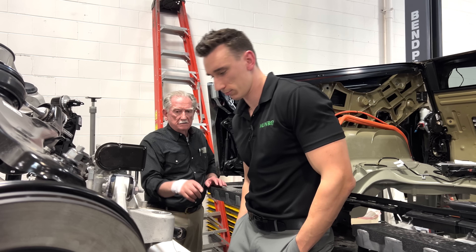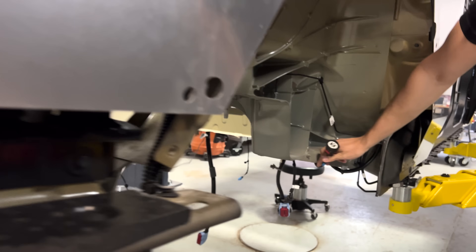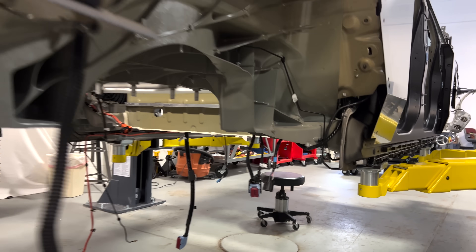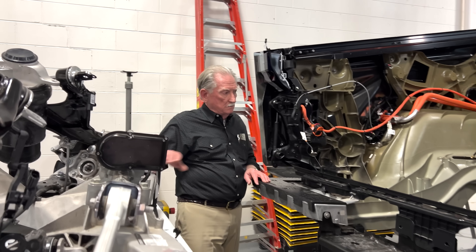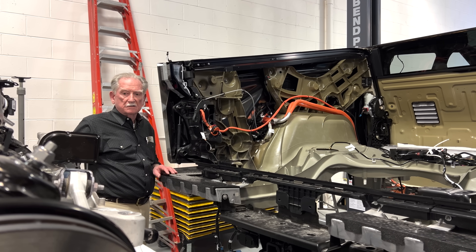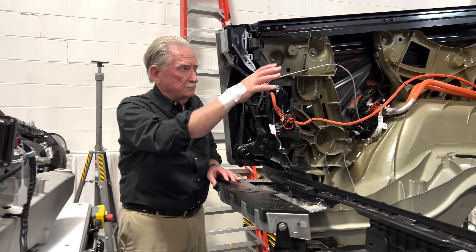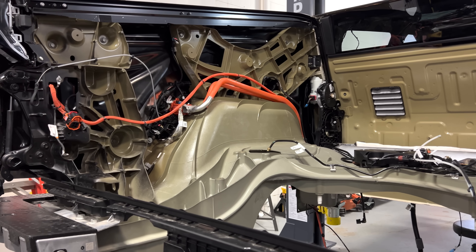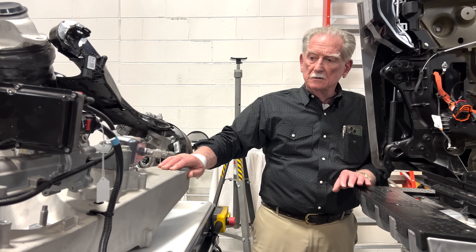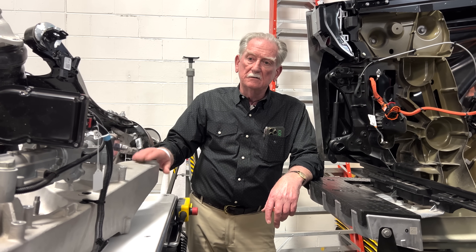This connector connects to that one, and you can see how much of this product is being shoved underneath the vehicle. You've got this cross-car beam somewhere in front of the wheel wells. This thing is definitely a monster. We look at the castings we've talked about in the past for the truck itself, but we also have these other castings here that are not as elegant as what you've seen elsewhere — because they don't have to be. These are not high-speed die castings.